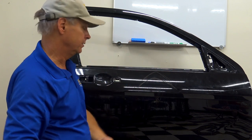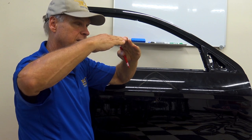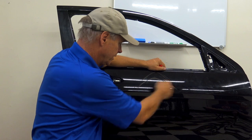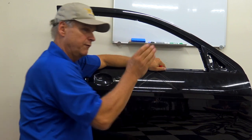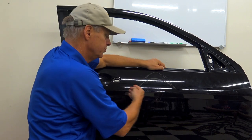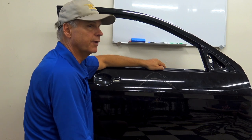So remember we said, when you get a pressure trap there, what it generally does is slightly dull out your body line. Okay, so if that was the size of our dent, you can count from about there all the way to there. Just as you get your head back and really look down that panel, you'll see it. Just the slightest little low all across that. You better be addressing that fairly fast.